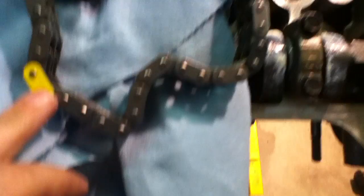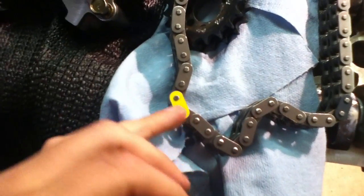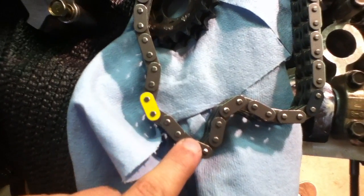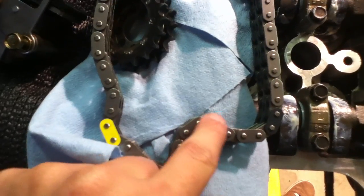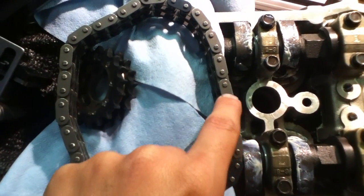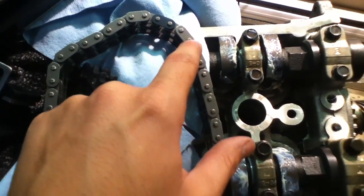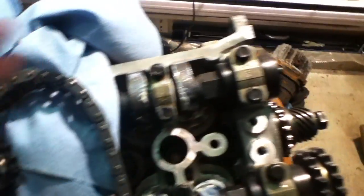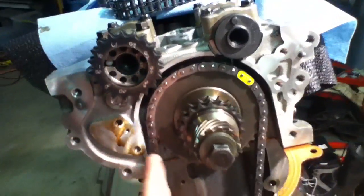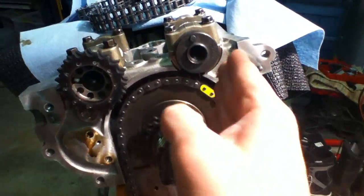There are essentially six links, but the way I always count it is starting from where the tooth would sit — I go 1, 2, 3, 4, 5, 6, 7, 8, 9, 10, 11, 12, 13, 14. And then on the other side it's the same: 1 through 14. This side here is actually longer. The long side is along the intake side. So you have your 14 marks and 14 marks up there on the top, and the long side goes on the intake side.